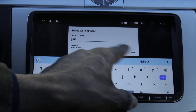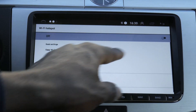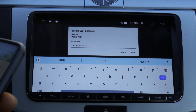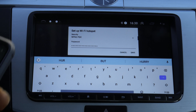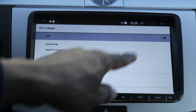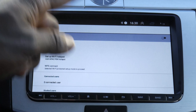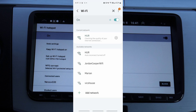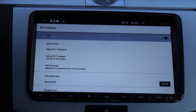In this particular case I have entered those details — H-U-R — and then the password as the one showing on the cell phone in the wireless Wi-Fi Launcher app. Once you set that up, click on save and then turn on your hotspot. Then on your phone you look for this wireless Wi-Fi network. It says H-U-R, connected without internet — that's exactly what is going to happen, which means you're already connected.